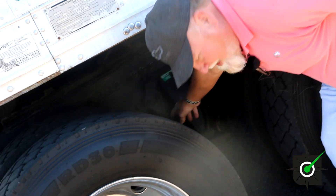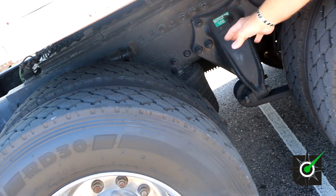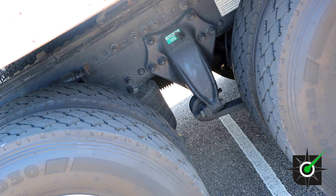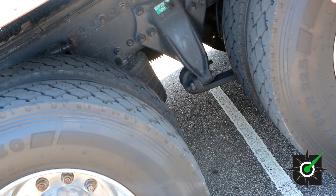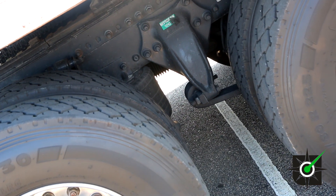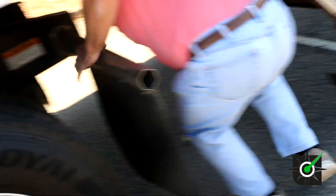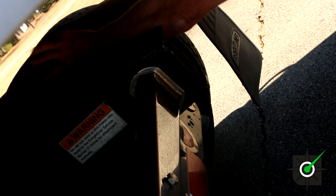We have an air ride system — we have an airbag. That airbag is properly mounted and secure at both ends. It's rubber, so there's no cuts and abrasions. Underneath here, you have to point and tell them the locking jaws of the fifth wheel are securely locked around the king pin, and it's properly greased. You have reflectors and lights back here — you've got to describe your lights. These are reflectors — they're red in color, properly mounted and secure, not bent, cracked, or damaged.